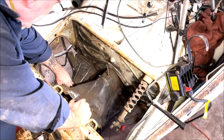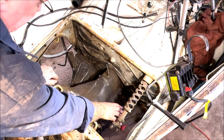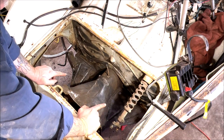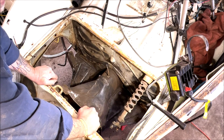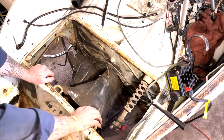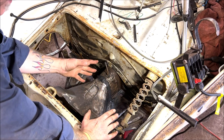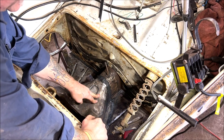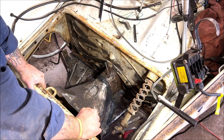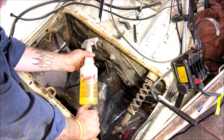So we got one side cleaned up here. I'm going to take a wire brush and get inside of there, pause the camera temporarily, clean this side up — just so you can see what I was doing. Before I wipe anything down I'll be right back and show you the Rust Bullet procedure. As you can see now I have it all cleaned up. I went ahead and wire wheeled everything — you don't have to get every ounce off. Even Rust Bullet says you can knock off all the loose stuff on a truck frame and just wire brush it the best you can.